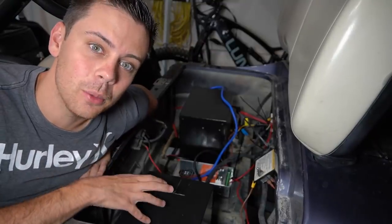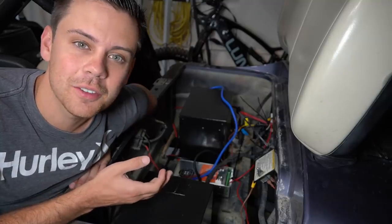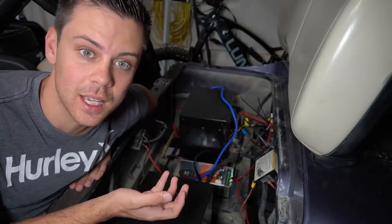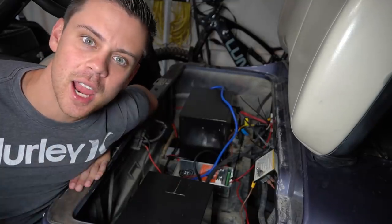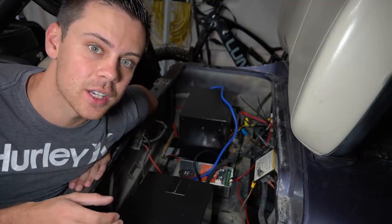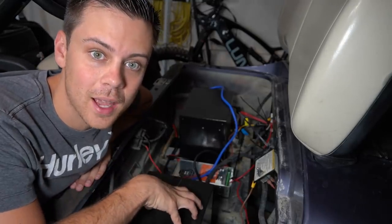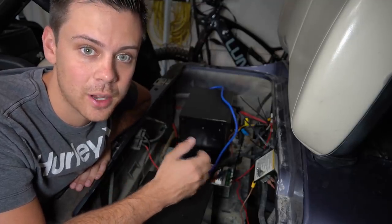A week later, after the Battleborns failed, I was planning on building my own battery pack, but I couldn't find a 16s BMS for lithium iron phosphate that would ship fast enough due to shipment delays. So I told Big Battery about my problem and they're actually going to change their golf cart conversion listing. The previous battery was perfect for 36-volt golf carts but not great for 48 volts, so they're going to offer two Tesla Model 3 packs in series for higher voltage and better performance.